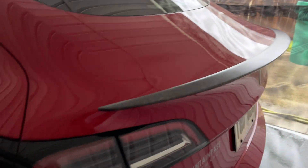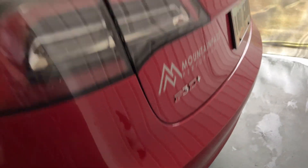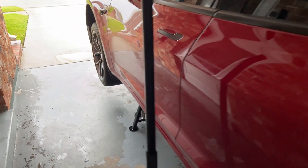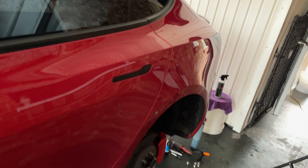And if you do release the park brake — that e-brake — for, say, doing the cleaning like I'm doing, I have some bricks there just to kind of hold the tire in place. But it's not gone anywhere because the jack stands themselves are holding enough force on the car where it's not going to roll.